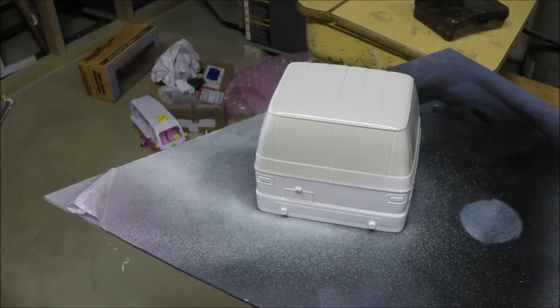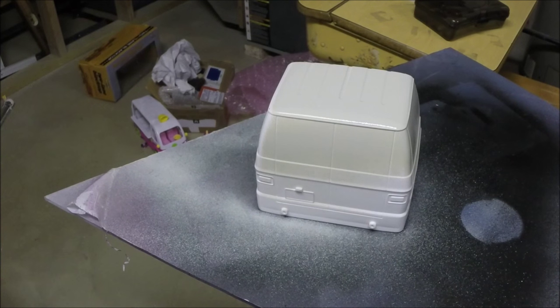Even with cars, when my dad was painting cars back in the day, and my uncles, guys would paint cars lacquer and they would put it on super, super dry because they were afraid to get runs, and then they would rub it out and buff it, and then it would look okay. But a real painter could put the paint on nice and wet, an enamel job, and put it on super wet, like we're using here, this is enamel, and get it to look super shiny and nice and even, because the painter knows that threshold.